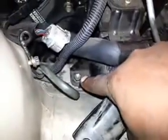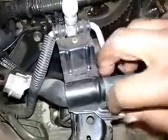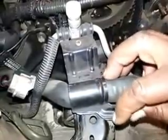Then you have four more bolts. You have two 14mm down at the bottom that hold the motor mount — one here and one here. Then you have a 12mm that I already removed that holds the motor mount. There's one more little trick: remove this little 10mm right here. Now I want to take it off and show you how you slide that timing belt across without taking out your AC or anything else like that.